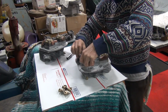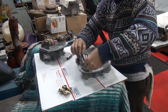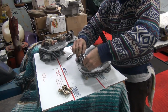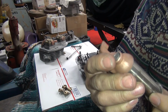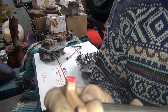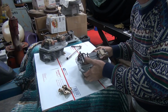So, see how close we are this time. Still sweeps pretty bad across the face, but doesn't dig in like it was. All right, what do we got? My angle's gone away. Damn. It's only hitting on the inside edge now. Why that's changed. But the contact is starting to look better. So I can go back and hit that again. Thought I had it.